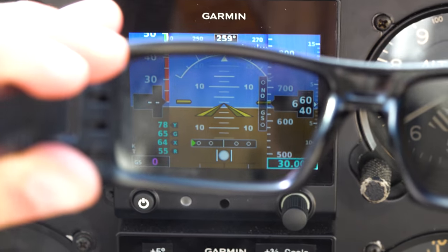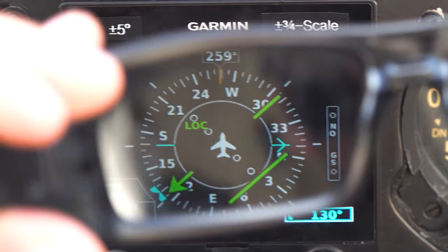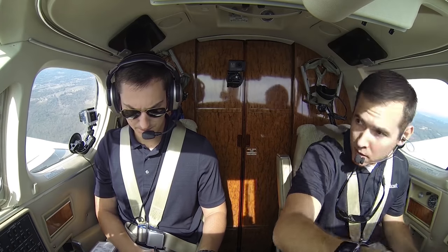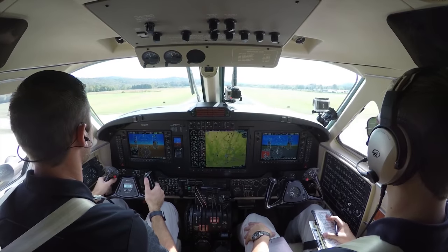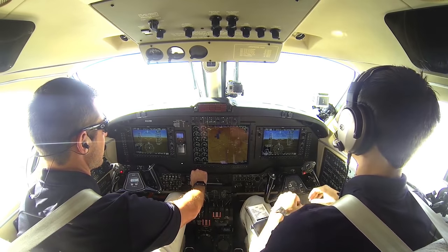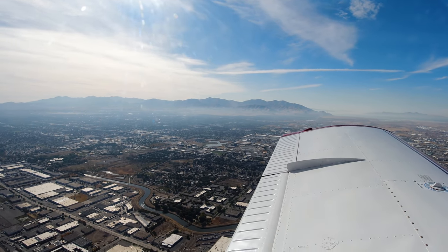This becomes a huge problem in modern aircraft with electronic displays on the panel. In our 172, you can see that on both of our primary flight displays, the avionics stack, and the engine monitor, we get distortion and dimming with polarized lenses. Another item to consider is windshield heat in an aircraft. Windshields are often heated by a parallel series of filament wires that run through the windshield. My buddy Justin told me that when the windshield heat was on in the King Air, his polarized lenses distorted the glass and caused a rainbow pattern — really distorting the image out the windshield.